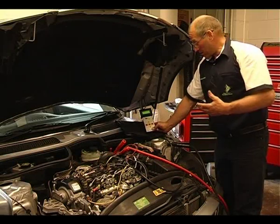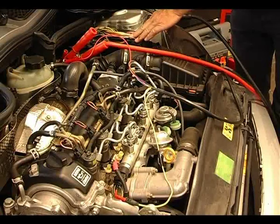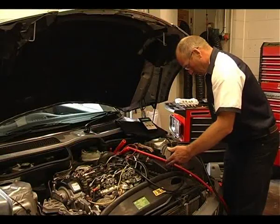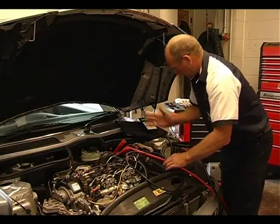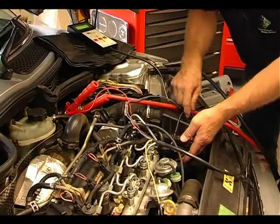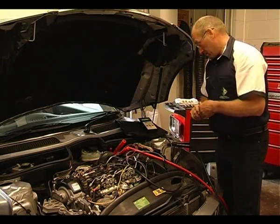All of those tests have been done very promptly and very effectively, simply using this tool as a pressure gauge and no more. What I'd now like to do is introduce this tool to control this valve independently of the ECU, and we do that by applying a couple of simple adapters. We remove ECU control and attach this interface, which now connects to the tool. We also need to put this dummy load in so that the ECU thinks there is still a component there — because if it saw an open circuit, it would go into default. So we've effectively fooled the ECU. We're now monitoring pressure and have control of the pressure regulator.